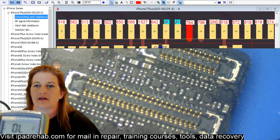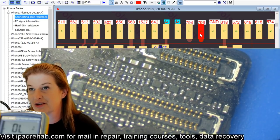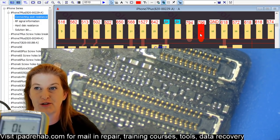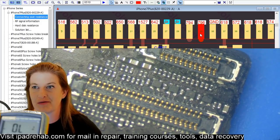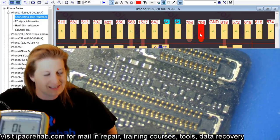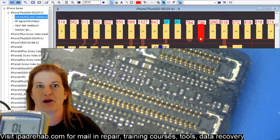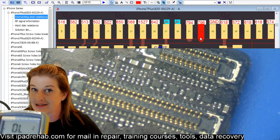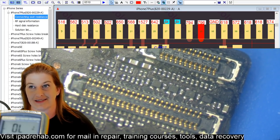The pin one above ground — what is it in ZXW? It's 'MIPI AP to LCM CLK connector N.' What does that mean? AP is application processor; LCM is liquid crystal matrix — the screen; CLK is clock. Clock sounds really data-related and potentially very important: CPU to screen, clock and data. That sounds super hot for image and not like backlight at all. It's something the good board has, something ZXW has, and something the bad board shows as open line. Time to hunt down where this line has gone wrong.